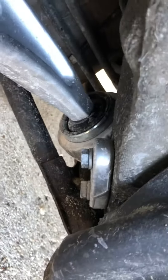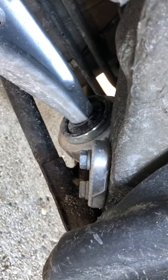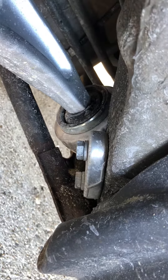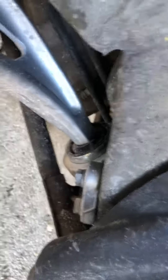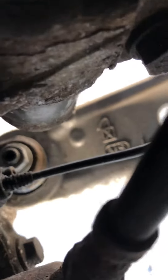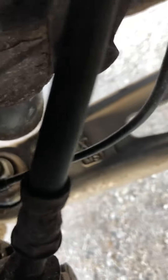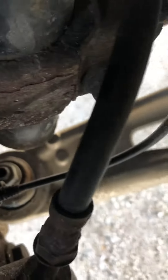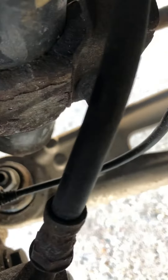When I put this control arm on I didn't use an impact wrench or heat on that bottom bolt. It took me a couple weeks to drill that out and tap it. I had to go buy the ball joint separator fork up at Harbor Freight for $10 and have a friend bang the hell out of that to get the ball joint out.